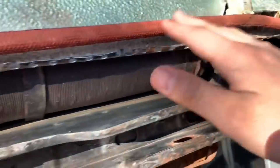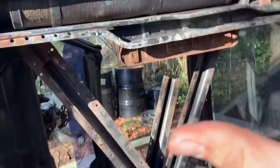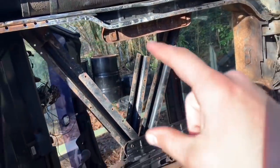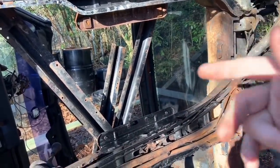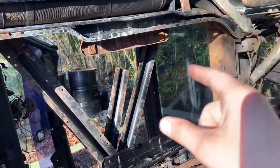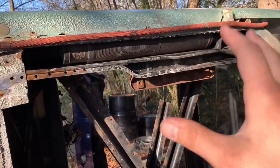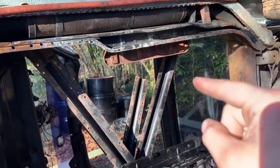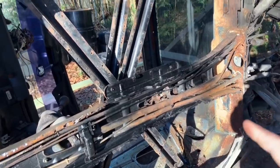See a lot going on here. Getting there. So the reason I think this is the way it is — when the seats were in this car at some point in time, the springs had given out and they had stuck some plywood up under here. Not only did that hold moisture on the carpet when the carpet got wet and never let it dry out, but it held moisture itself. And that's really what came down to making that floor rot as bad as it did. That's why I think most of the car realistically is pretty solid structurally, but these floors got rotted out. So once we get all this taken care of and cleaned up, I think we'll be moving along pretty well.